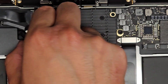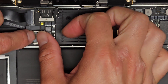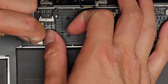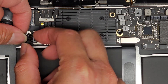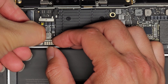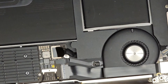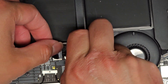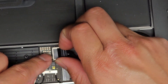We're going to go ahead and peel this up and disconnect the battery. You have the little connector here — I'm going to use my fingernail and kind of go side to side to slowly walk it out. If it doesn't come out, you might have to get underneath here and help pull this up slightly while you push that back. This connector can be kind of tough to pull out. I'm going to try and grab the cabling — there we go, we got the battery connection out.